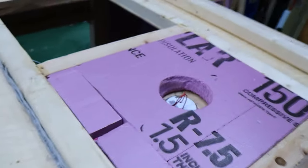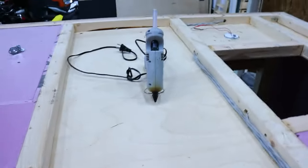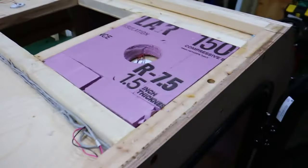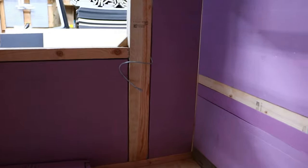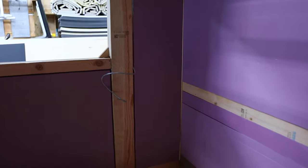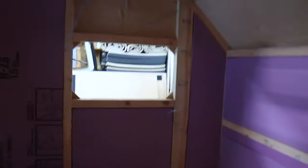Here's another update — I have the lights all wired up, everything pretty much wired up. I have all the wires dabbed up with some glue, real ugly looking, just to hold them temporarily while I put the insulation in. I'll do a whole wiring diagram for all the components. This right here has both interior lights wired up on a circuit, the fan circuit's in there, and the two circuits for the outside lights are in. There's also another circuit I forgot to mention — I have two wires up by where the pillars would be that are going to get constant 12-volt power. Those are going to be little reading lights that also have a USB charger, so you can charge your phone in those spots.